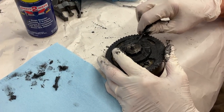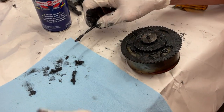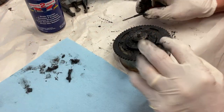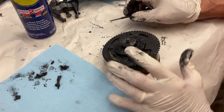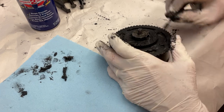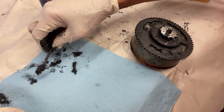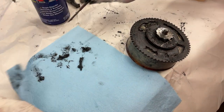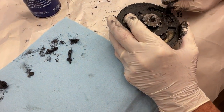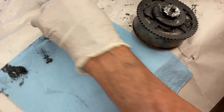I've been reading online that some people just take the whole barrel and soak it in gasoline — no. People think you can soak it in gasoline and go with it. You have to take the barrel apart and check everything. You don't soak these things in gasoline or lacquer thinner and expect it to run. Every square inch of phonograph motor has to be cleaned before you assemble it, or it won't run.